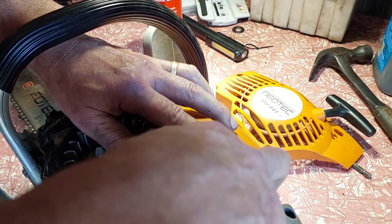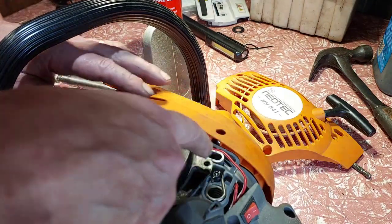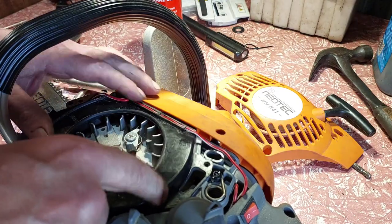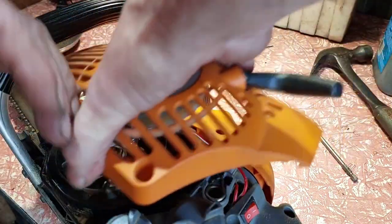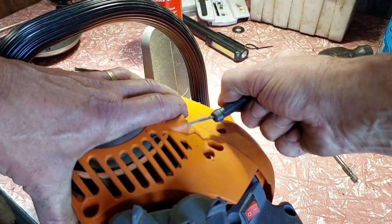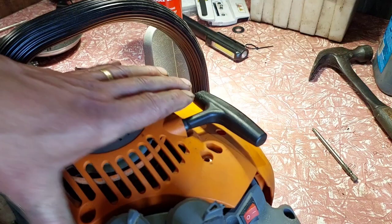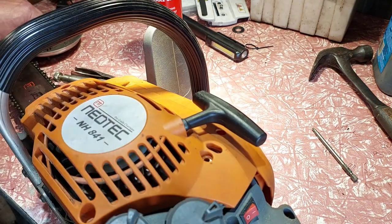Oh, sorry, it goes there. Goes above that and there, so I didn't even know myself. So the wire goes through there, so you get your mixture screws. But there, you're all lined up. Put that back on again. Give it a pull until it drops in place. Make sure your screws all line up. Yep, and screw it back on.